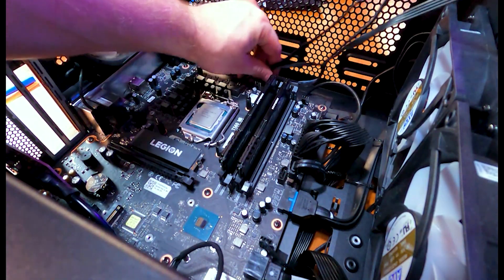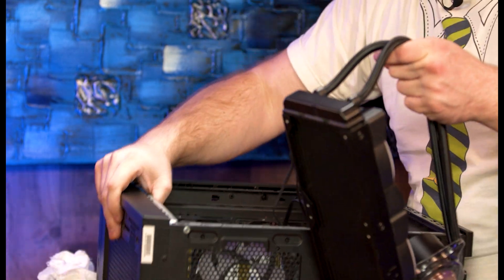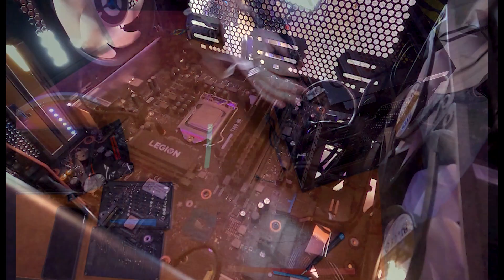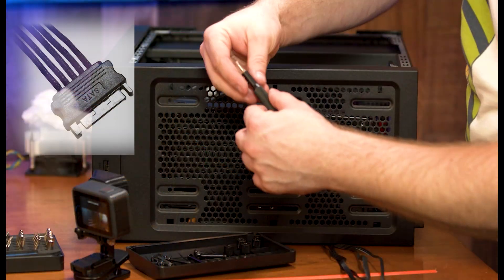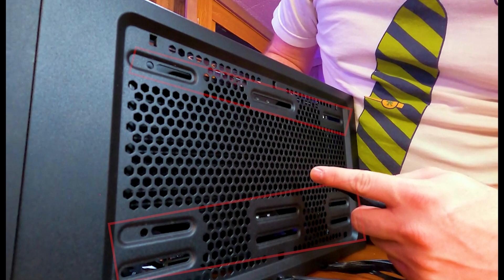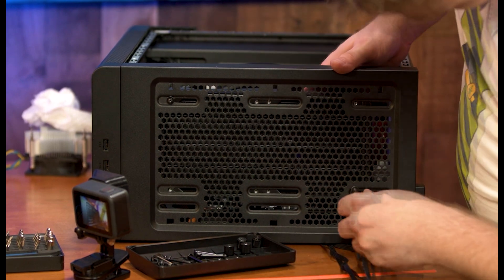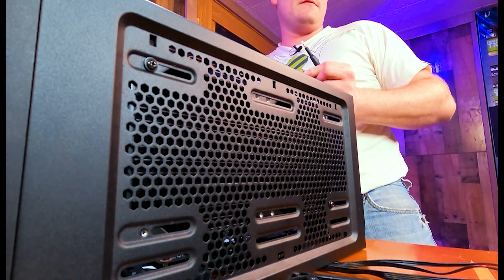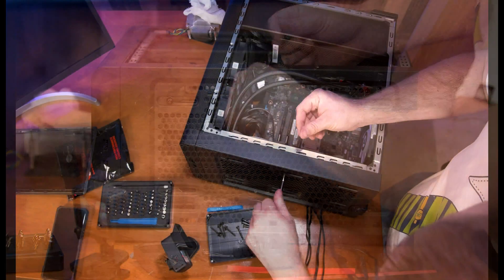Now we're going to start feeding in our ball of wires towards the top — this is kind of hard because there are a bunch of clasps that get stuck, so take your time. We're feeding them through so the wires aren't sitting inside the case disrupting airflow or looking messy. There are three important plugs: one set of power, one PWM for the fan controller, and one that plugs back into the water block AIO. Installing the radiator now — they have slotted holes. I push it all the way forward since I also installed a 2080 Super with a hybrid cooler, which shows you how many radiators can fit in this Legion case. You could put a 240 or 280 on top and a 120 in the rear for true water cooling.